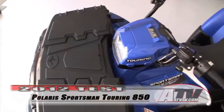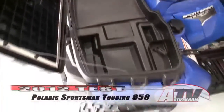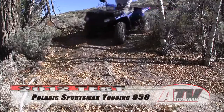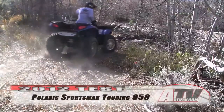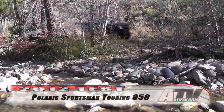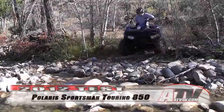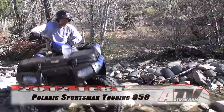The bad? Like every Polaris, the XP takes far too many revs to get it moving, and the power steering is overpowered and lacks any feeling. The composite racks make fastening miscellaneous stuff like fuel packs pretty difficult, and although we still dislike single lever braking to all 4 wheels, that takes a backseat to the rear wheel only engine braking in the what-were-they-thinking category.